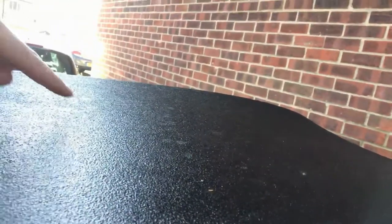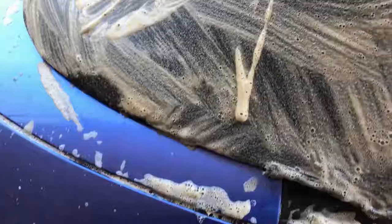Right, guys, so we've given the soft top a good clean with the bristle brush, just going in straight lines, no circles. And then what we're going to use is some of this Meguiar's convertible top cleaner, just try and get that into all the stains that are on the roof. So all these marks here, we've got a lot of the mould and the grime out of it already, but there is still some on this, and that's only done it with the water, so I'm going to try and use this stuff and see if we can get a better result.